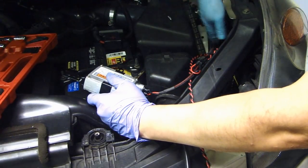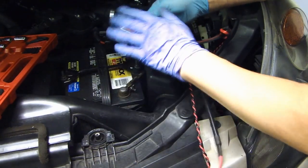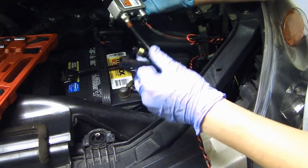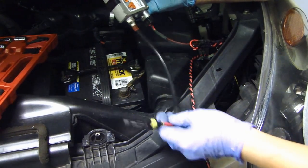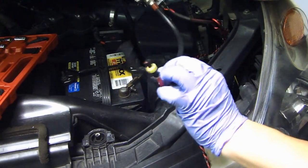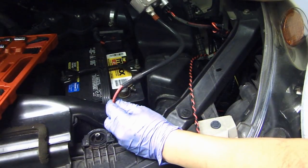So after I connect to the ground and the power, the output of the relay will go to the ballast. And this is going to be the output to the HID bulb. I'll be installing this ballast somewhere down below here, and then drop this cable down below where the fog light is and connect it up.